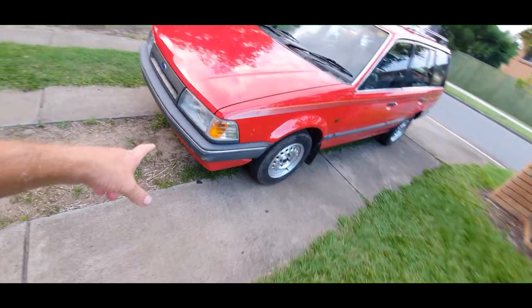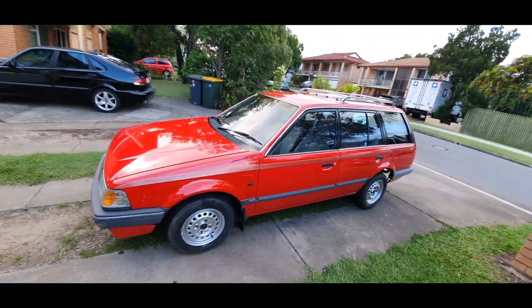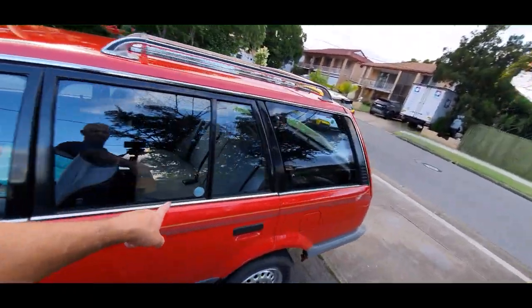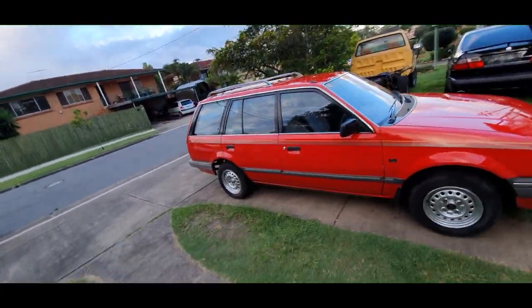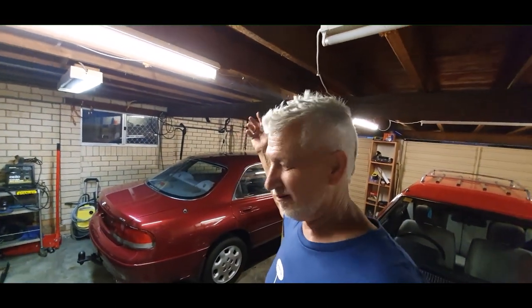That's surprising how much that stands out now. Mate, that looks absolutely amazing. Progress! The Mazda 626 has had the full service today - changed the front tappet cover gasket, did two engine mounts. The third one I can't do - it's too hard. Same with the rear gasket - I'm just going to put those in with the spares and tell the buyer to take a bit off if they want a mechanic to do it.